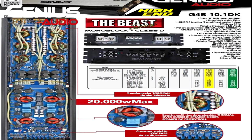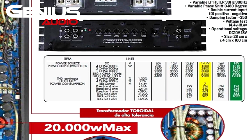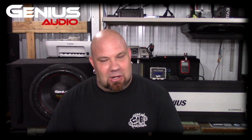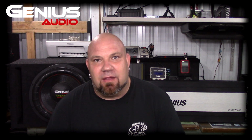Luckily, Genius gives us the power output at 10 volts, 12 volts, 14 volts, 16 volts, and 18 volts. So as long as I'm within the power ratings that they show at whatever voltage my bench drops to when I run it, then I'm happy, because then I know they're not lying about the numbers. If I'm below what they say, then I can assume that this amp doesn't really hit anything that they have listed.